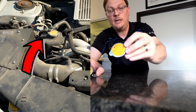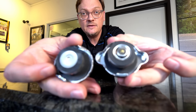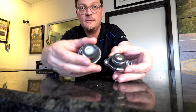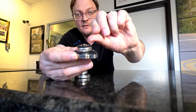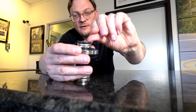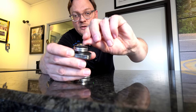And this is the two-way cap. Now, if you're looking at just a radiator cap, how can you tell if it's a one-way cap or a two-way cap? Very easy — look at the back. You can see that the two-way cap has got a little bit of a dome; the one-way cap is flat. Now, this dome is the second valve. One valve is the spring, which you can compress. But then this valve — if you just pull it up a little bit, the dome opens up. There's a little spring underneath here too, so that opens when there is a void in the cooling system, and that's what allows coolant back into the system.